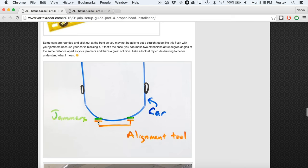With the bent straight edge, since you can't run it directly from one jammer head to the other, you do a 90-degree turn on each end pointing forward, place those flush against the laser jammer, and that ensures they're straight — you're just accommodating for a bulge in front of the car. Eyeballing it is generally really tough to do — I've seen people try laser sights and all that, but it really is best to get some sort of straight edge and measure them that way.